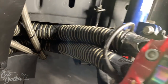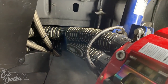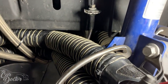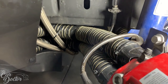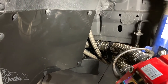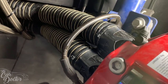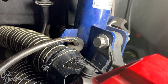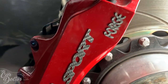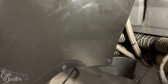The piece is hidden, they swoop around here and go there. We also tested them with the wheel all the way to the right — right now they're turned all the way to the left — and they don't interfere with anything and they have a nice fold. So there they are installed. We have the mSport big brake kit ducts installed, and even though they're not meant for our setup we made it work with just that one bolt holding the bracket, giving us nice airflow into the big brake kit.